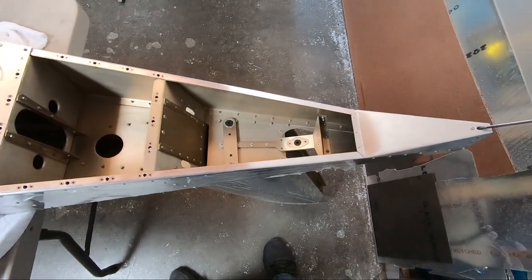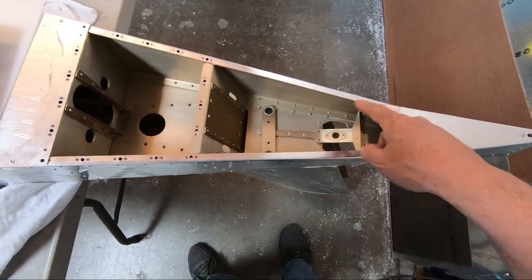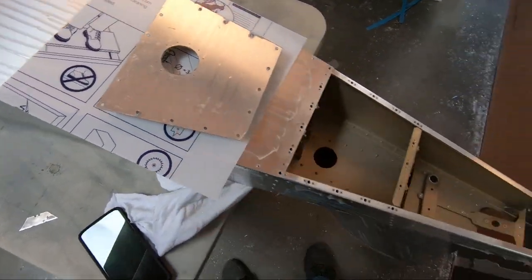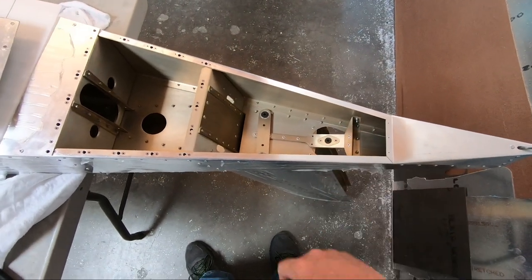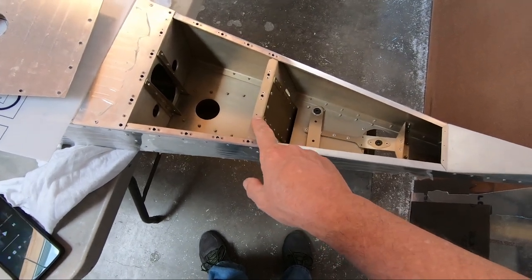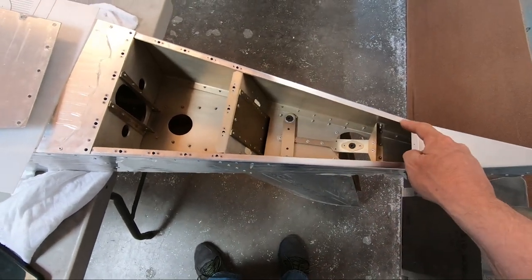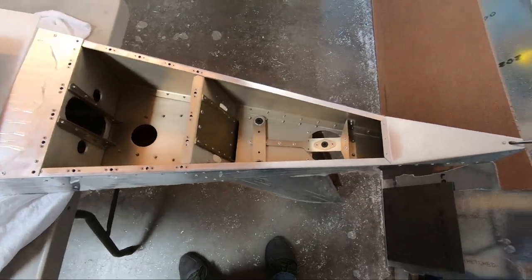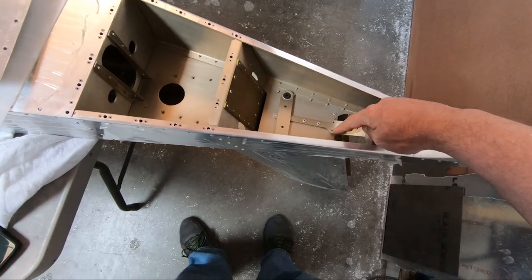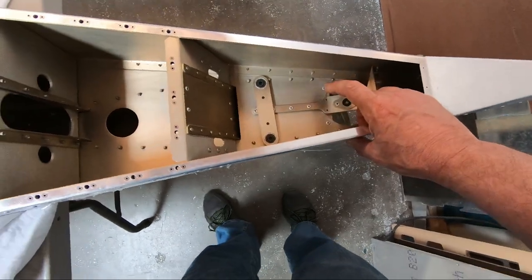I think what I'm going to do is make a panel and put an inspection window located right above the mount for the rudder and the bearing attachments, so I have a sight window to inspect between annual inspections. Then make it so this panel comes off so that once a year I can take it off for annual inspection. I'm going to do a CAD drawing for this panel, see if I can get it cut with a sight window in it, and use the Lexan material to cut out circles to pop rivet into place for the inspection windows. I'm still waiting for the bolts that mount on the aft spar for the vertical fin — I decided to go with just number 4 bolts.